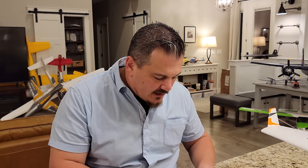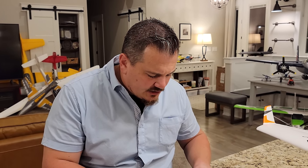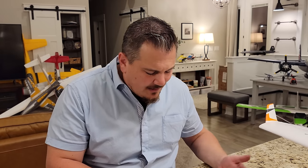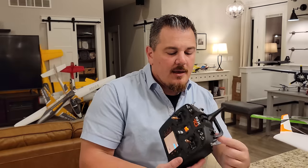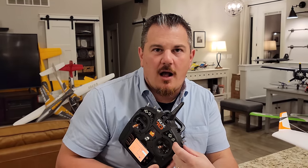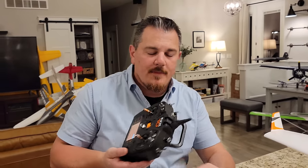That's fine. But they're saying switch F for the ailerons and switch C for the elevator. And I'm like, what is that compared to the next model? How are you going to remember that C is that and F is that? You're not ever going to remember that. I have done that same switch for hundreds of planes. The only time we deviate is if we have retracts or not. Because then sometimes I'll put safe over here because it's a little easier for me to get.